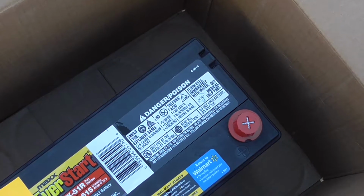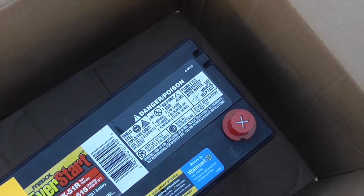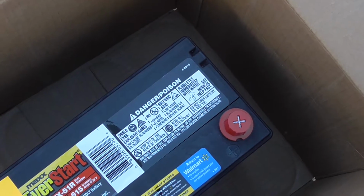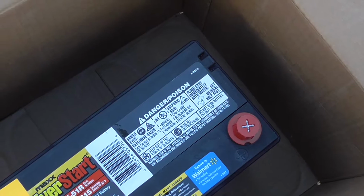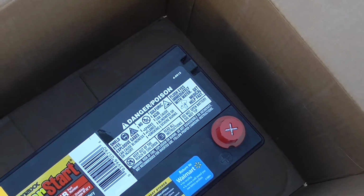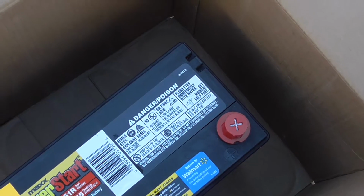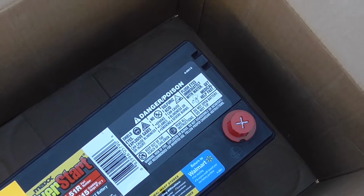And again, this is a common battery because it goes into 4-cylinder Accords, and I'm sure other vehicles too. It's a Group 51 reverse case for the 4-cylinder. 6 cylinders, different animal. I believe a Group 35, but I'm not 100% sure. Of course, consult your owner's manual and look at your battery before buying.